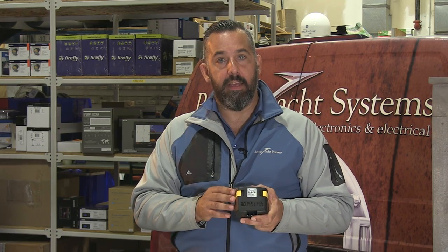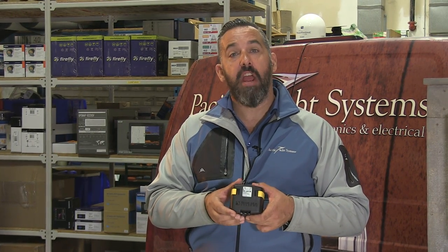They're pretty smart. They're going to combine your batteries only whenever you get a charge voltage — on average about 13.3 volts — which is a time of plenty. Why not share that charge with other batteries? My battery is sufficiently charged that I can start sharing a charge with other batteries that are put into combination or combined with another battery.